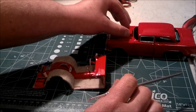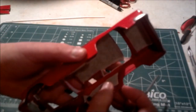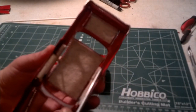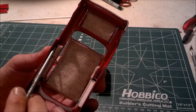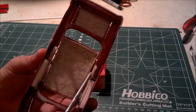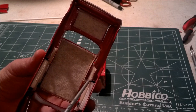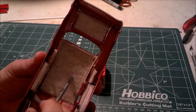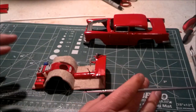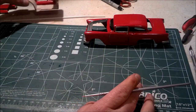And also you have to take into consideration whether this car is going to have interior panels like this one, because you have to take into account this measurement here, okay? So you want to measure from this interior panel to this one, and from the base of this panel, where it's going to meet the floor, to the roof, okay? So after you've gotten those measurements and you wrote them down, then you can start your main hoop.